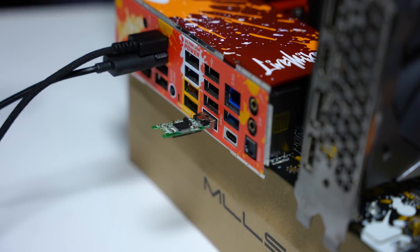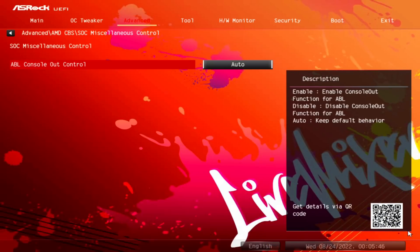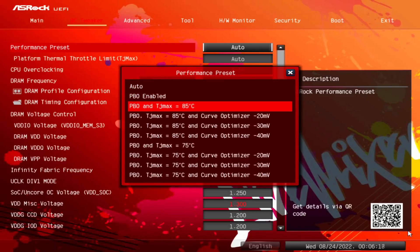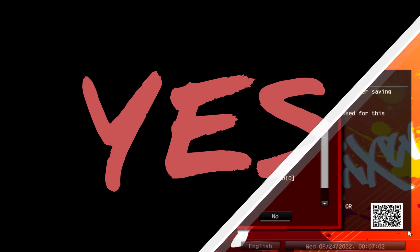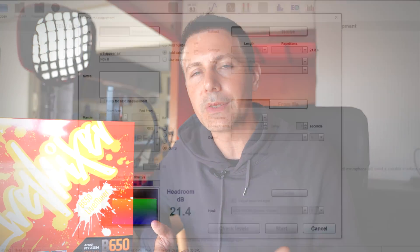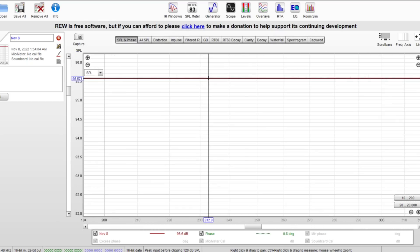In terms of tuning the CPU and memory, all the features were there except core control — I couldn't find that within the B650 BIOS, so maybe that's a feature exclusive to X670E. However, in Windows you can still fully utilize Ryzen Master for quickly figuring out overclocks before locking them in on the BIOS, and you've also got the Curve Optimizer embedded within the BIOS. The BIOS works really well — ASRock need to change nothing when it comes to their BIOSes. As for onboard audio, the board features a Realtek ALC897 which, when I tested the numbers, came up extremely good despite being a Realtek, even looking at enthusiast-grade audio.